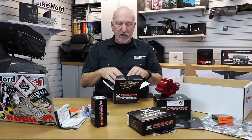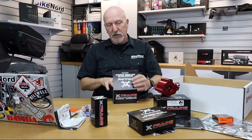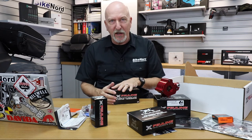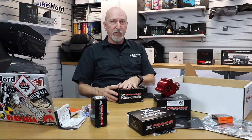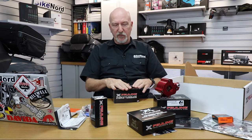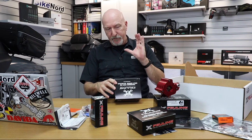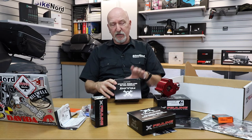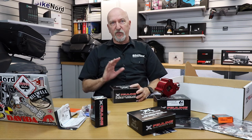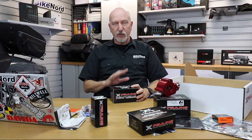I like my CVO to be a little bit smoother and less noisy. I want it to have a little bit of the race feeling but at the same time I want to keep the feeling of a touring bike. So I don't want to have a too noisy engine that disturbs my ride. That's why I choose to go with the 1107 spring kit together with the cam chest kit, just to make the engine a little bit less noisy.